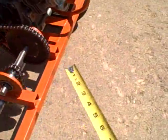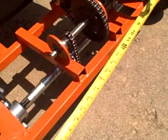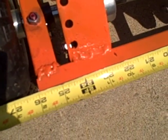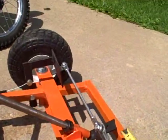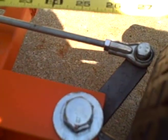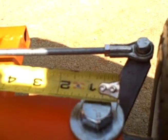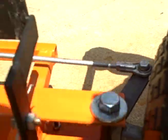This axle came from Northern Tool — their smaller go-kart axle, still 1 inch. The width on my frame is 26 inches at the rear, which means it's also going to be close to that for the front arms. From the front arm all the way to the corner is 26 inches. And my bolts that act as the spindles are drilled at about three-quarters back.